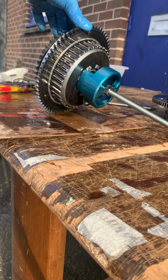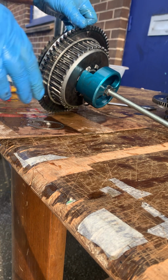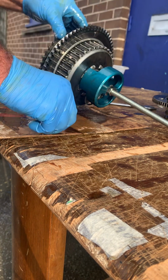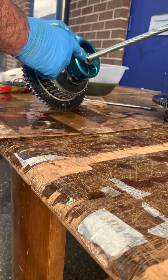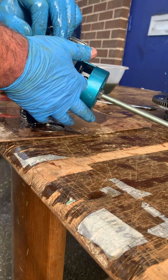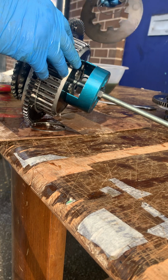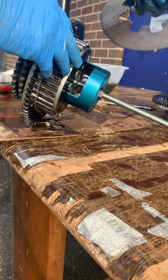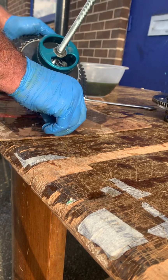Okay, you can see this clutch. We're putting this clutch back together. This is like an Evo clutch. Okay, now on this we've got the clutch tool through. We've got the ring in here, which goes on top of the spring plate. It basically goes like that on top of that. This is a warm one. We put all the clutch back together, put new plates in.